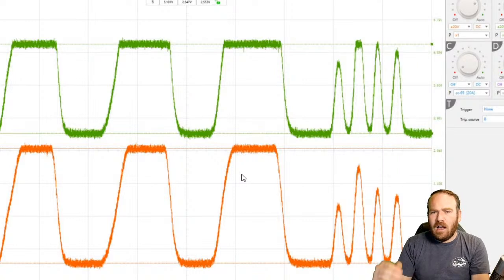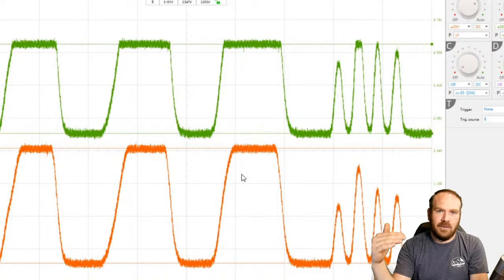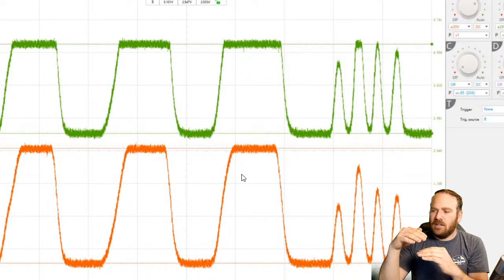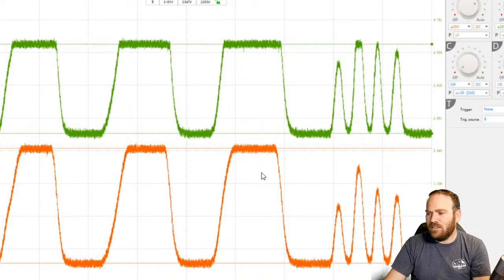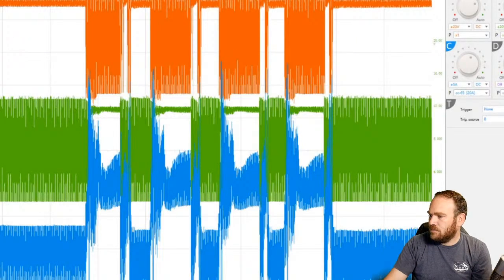But if we offset one of them, which Toyota is obviously doing by lifting it off of ground a little bit and starting from a higher point on TPS 2, then if they short together, the computer's like, hey, we got an issue. Both of our signals are identical and they're not supposed to be. No weird dropouts or glitches, and both of them go in the same direction. Some of the GMs and some of the other domestic vehicles will actually inverse each other.